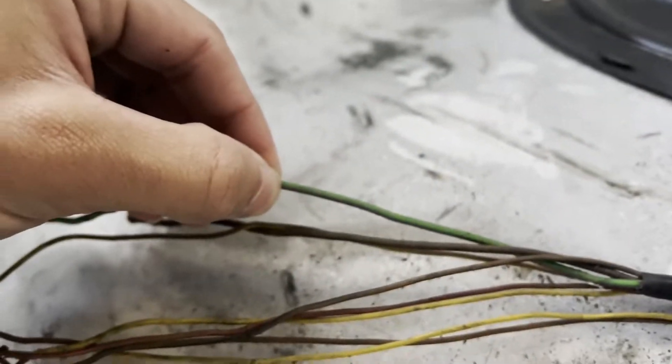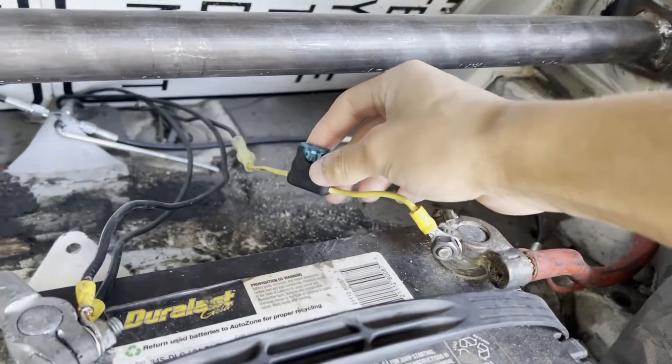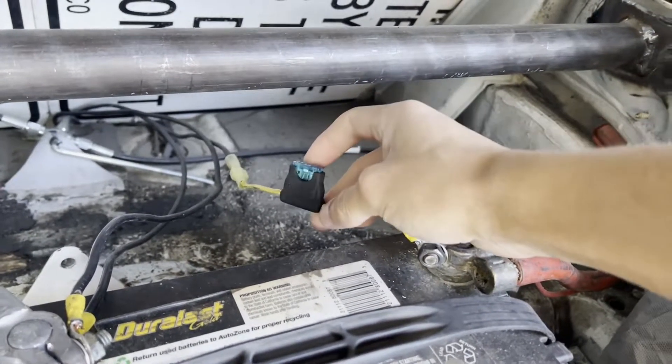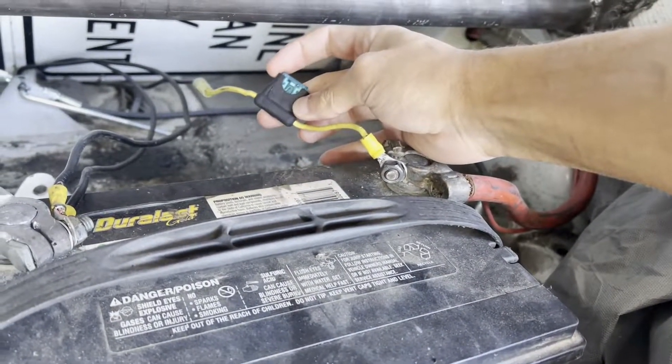If you've got an E36, it is your green wire in your fuel pump harness. This is our 12-volt going to the relay. You can get these little inline fuse holders at AutoZone — it's basically just a wire, you can crimp that in there, throw it in line, and then throw a regular fuse in there.